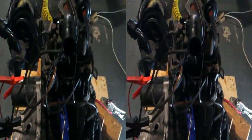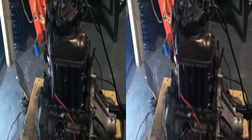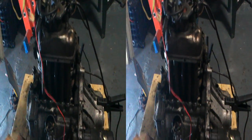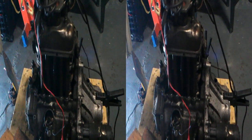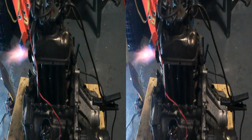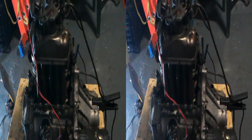Just to further this — I've just dropped the idle, as you can hear. See lots of nice fire coming out of there. Get it from this side because you can probably see it better. Look at that — you can see the flames coming out. What you're seeing there is unburned fuel, and that's the reason why turbos work, because there's loads of unburned fuel coming out of there, and that's still expanding as it comes out, and so that makes the turbo work efficiently.